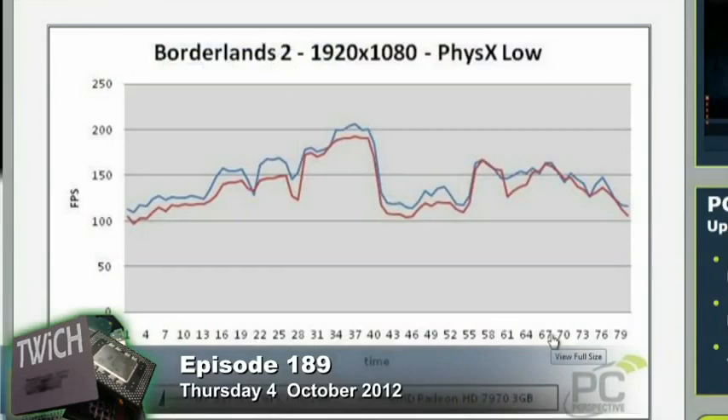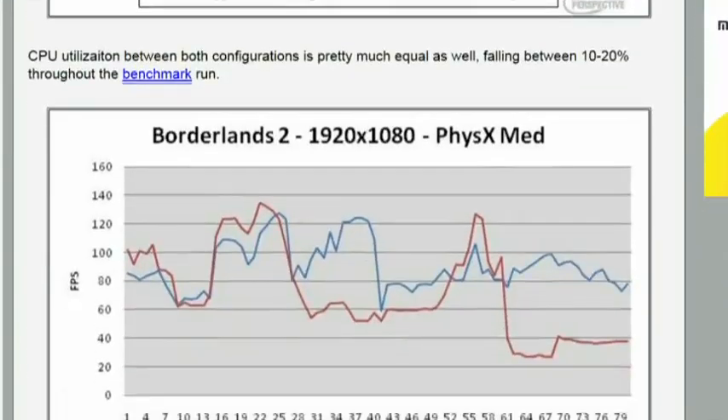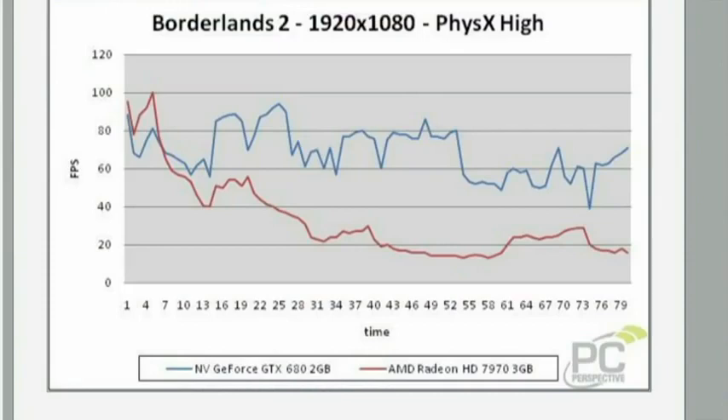The second half of the story compared an AMD card and an NVIDIA card — how much performance degraded going from high to medium to low on physics settings. We ran it at 1080p, maxed everything else out, and used the GTX 680 and the 7970 GHz Edition from AMD. What we found was that performance on the AMD card almost perfectly matched the NVIDIA card when PhysX was set to low — at low there's no GPU-accelerated PhysX at all, just CPU-based. When you get into medium, performance drops pretty substantially in certain cases. At high, performance drops off the cliff — we're talking about 66 versus 33 FPS for the averages.